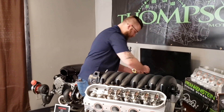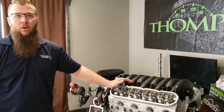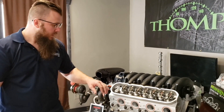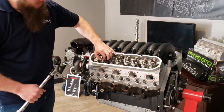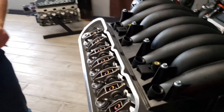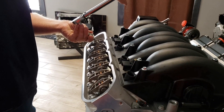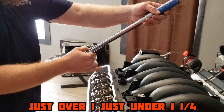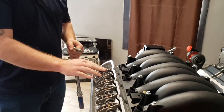We're now switching to an 8150 from an 8175. We're anticipating it's going to fall between one and one and a quarter turns — towards the top side of our pre-load range. That's going to help quieten everything down a little bit, but it'll fall in the usable range. We do the same procedure: set zero lash with no up or down movement but still lateral movement, torque to 25 foot-pounds from 12 o'clock, and we land just over one, just under one and a quarter. We've now found the proper length push rod.